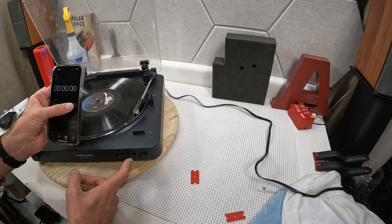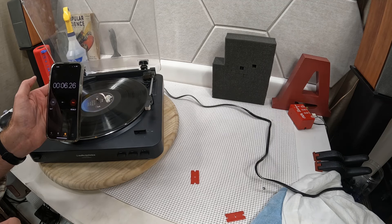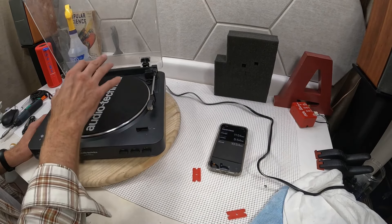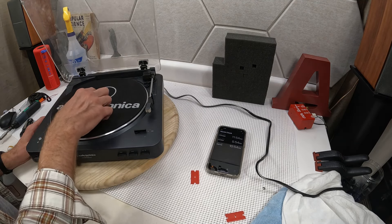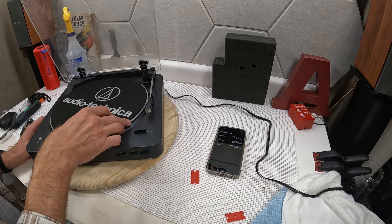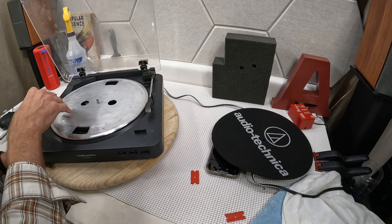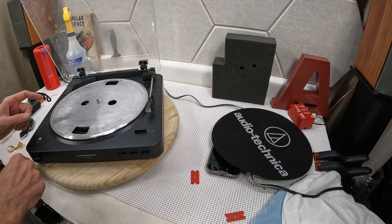Here is an original. The point on the spin times is that the original is facing more resistance based on the lubricant in the spindle and the motor not being lubricated from the top, and the fact that the platter weighs about as much as a soda can. So when we added more weight, it helps carry the momentum a lot more evenly, as well as reducing resistance from the motor and the spindle.